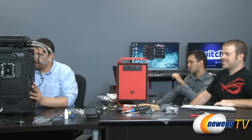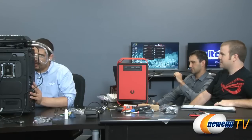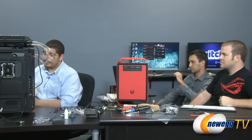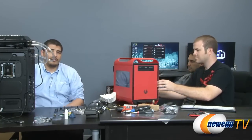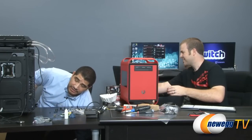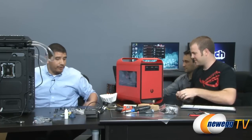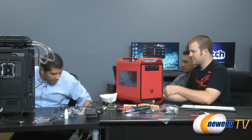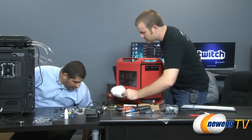Do the Asus GPUs and the Asus motherboards have a bypass to the NVIDIA voltage limit? We do in certain ways. On certain graphics cards, like the Asus 780 DirectCU II, they feature what's referred to as our GPU hot wire technology. When used with a compatible Asus series motherboard, you can run direct leads from the graphics card to the board that will allow you to drive additional voltage to it, so that you have more headroom. So there are ways for us to provide more power.